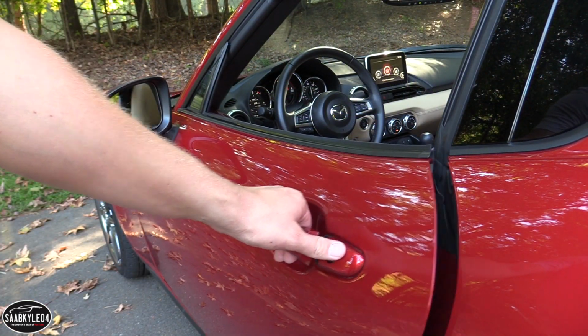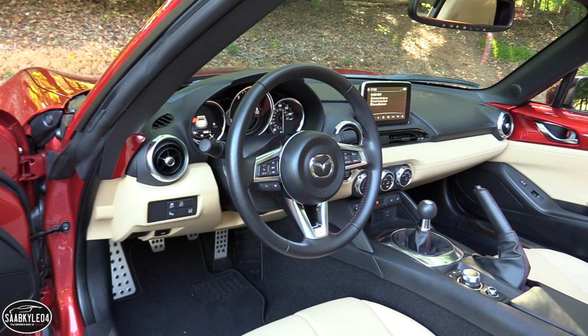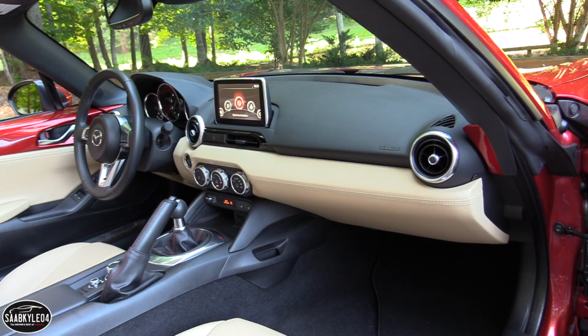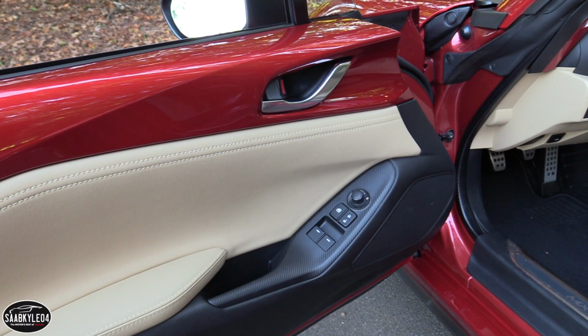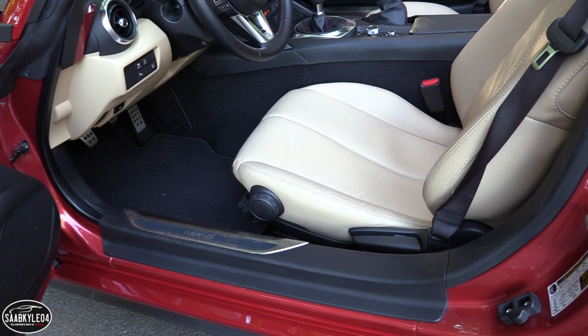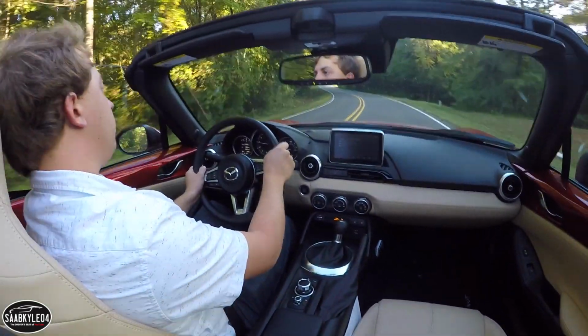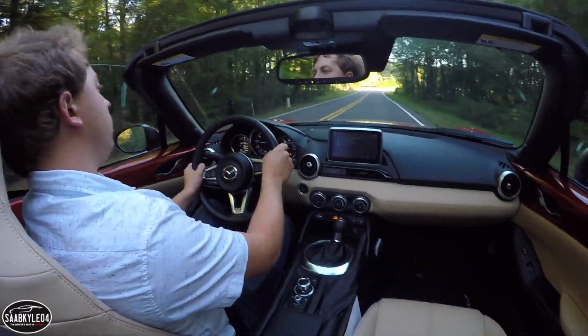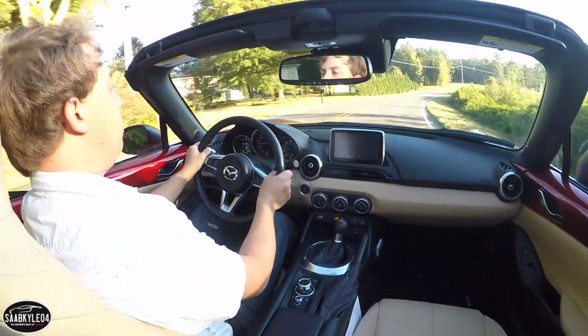Mazda made great strides with the all-new interior of the 4th Gen MX-5. It features a wealth of new technology, improved fit and finish, and greater passenger space. The latter isn't necessarily related to drastic dimension changes, but better utilization of available space. For example, the seats benefit from a new design that replaces traditional springs with a net and urethane material. This sheds 8.5 pounds per seat and allows them to be 35% thinner than their predecessors.